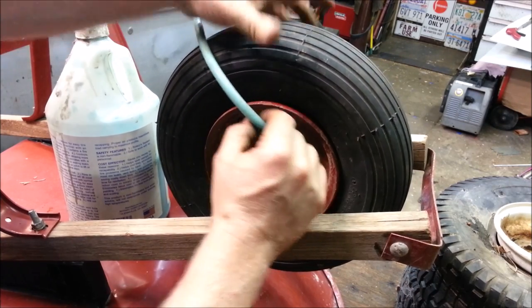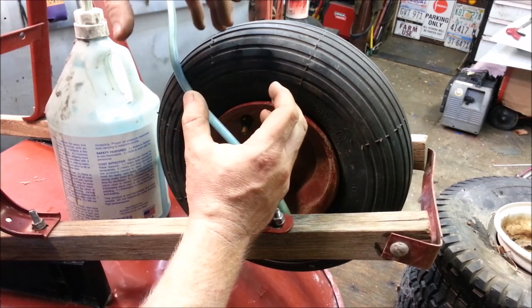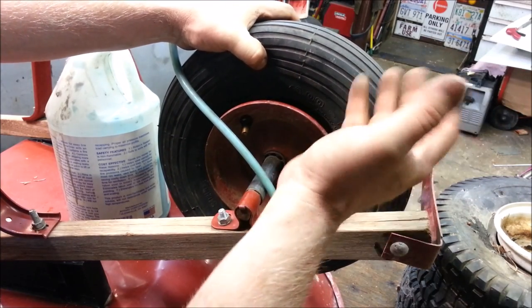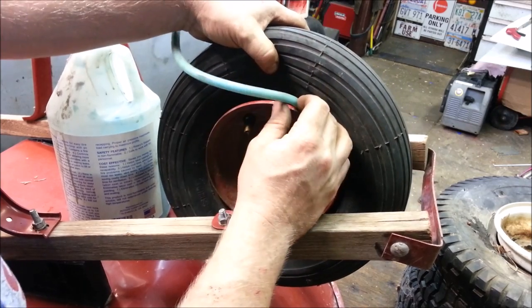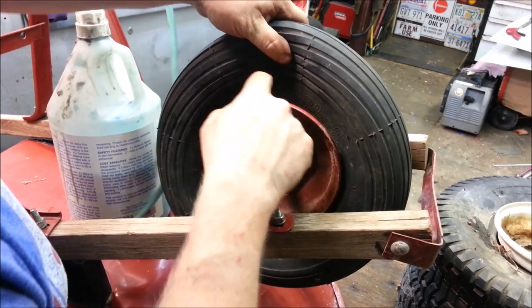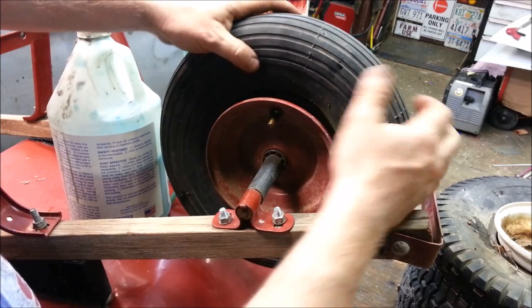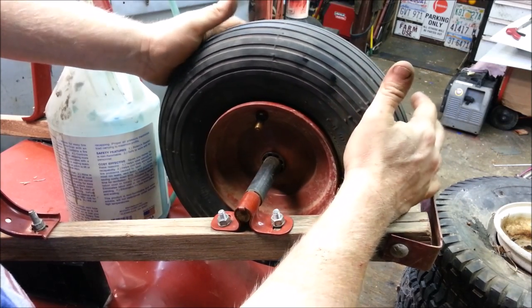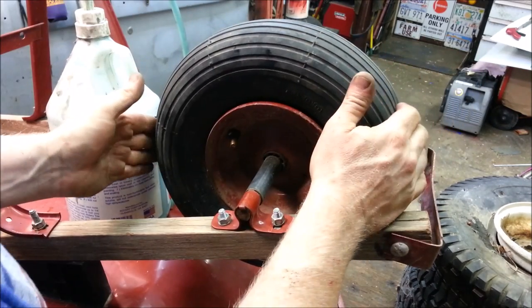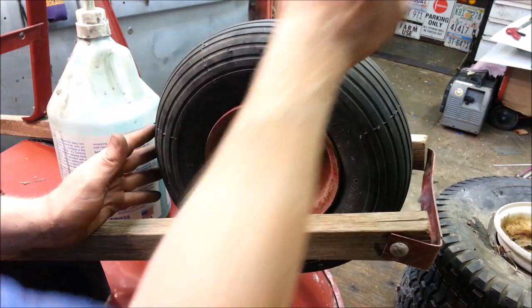You should be able to find a small bottle for about 10 bucks at Walmart. You only need about half of it — maybe two to five dollars worth. What we're going to do is inject some in and it's going to seal any large punctures we get in the future. But the biggest thing is to seal the bead area — seal that all the way along and keep this tubeless tire from popping off the bead. It's an airless tire right now, no air. And if you do decide to go the tube route, which is even better, inject this stuff into the tube as well.